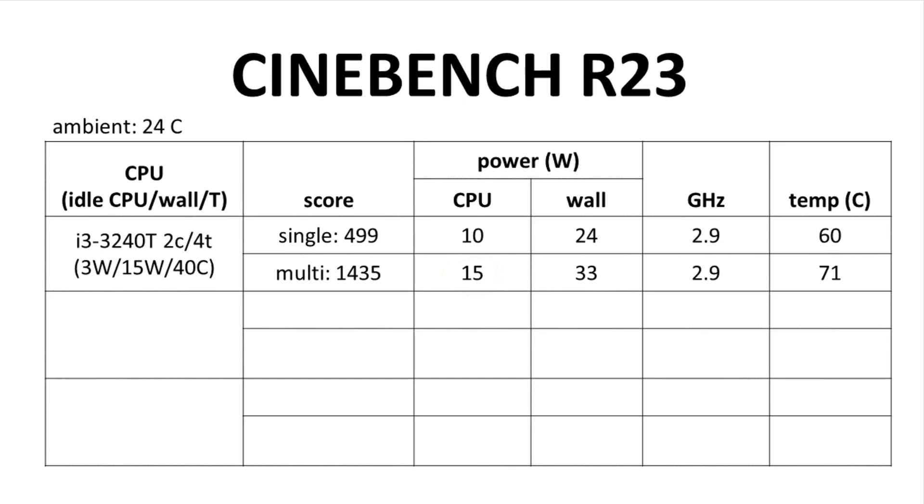Let's see a CPU with a little more power demand. I swapped in a low-power Sandy Bridge CPU, the Xeon E3-1260L. This is a 4-core, 8-thread CPU with a 45-watt TDP. It also can turbo, though I don't know its top power draw. Its clock speed is a bit lower than the i3 — 2.4 GHz versus 2.9 GHz.